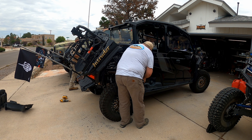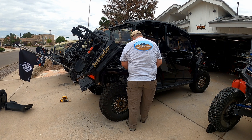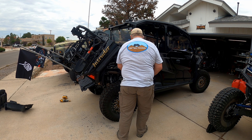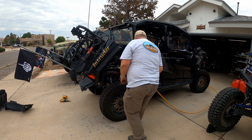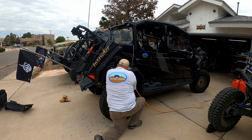I might add that when I change my oil on mine, I pull that lower panel off — it's just three push pins — and you can reach in behind the engine. But with these XL fender flares on there, they block a lot of access to the back of the engine and make it really difficult to get back there.